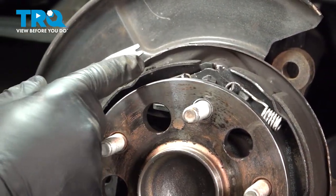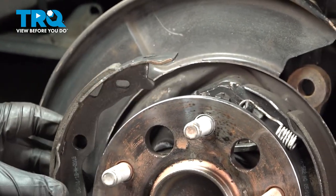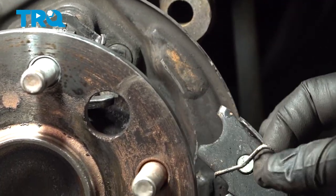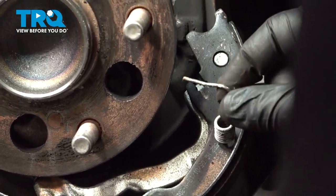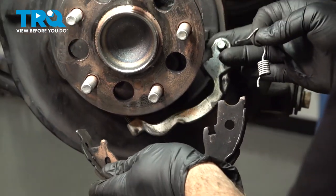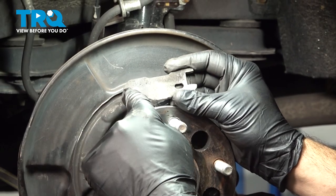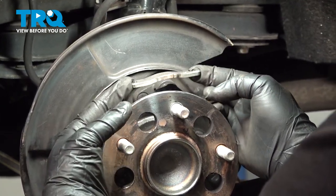Let's go ahead and remove our two upper springs using our spring tool with the notch in it. Once that spring releases, the shoe will come off. Repeat for the rearward shoe — apply a little bit of pressure and slide that off. Just want to remember where that spring came out of. Go ahead and work the e-brake actuator off the shoe and set these aside. Now down on the back here is a component whose little notches fit into notches on our e-brake shoes — these fit between both shoes horizontally.